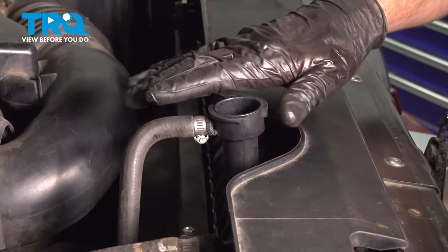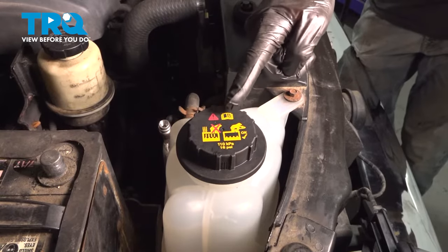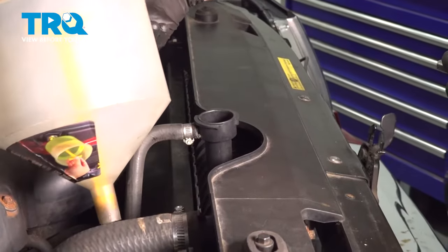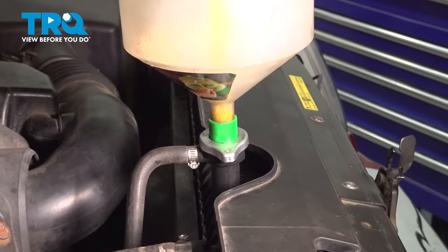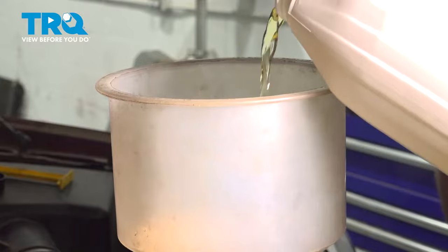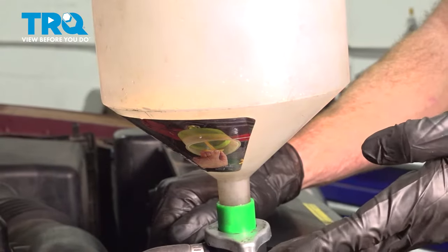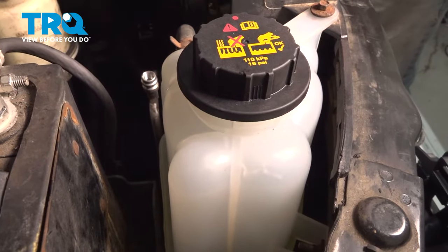Now it's going to be time to fill our cooling system. Keep in mind, this isn't a typical cooling system. It has the radiator fill port here, but all the way over towards the passenger side, you also have a pressurized overflow tank. This has to be filled up to a specific height, and the radiator has to be full as well. We're going to start filling this with a funnel. We'll take our little adapter and slide it into position. Once you have it on there, put your funnel on. Now we'll continue on by filling this up with 50-50 pre-diluted manufacturer-specified coolant. Now reconnect your negative battery terminal — slide it all the way up against the battery and tighten that mounting nut, making sure it's completely secured. Once you've fully filled up the radiator and found that as you were filling it, it also put the overflow tank up to the maximum, you can go ahead and remove the funnel from the area.